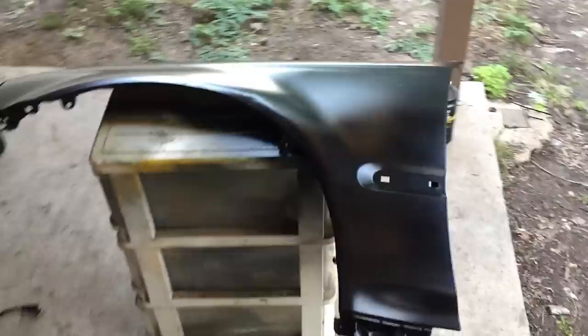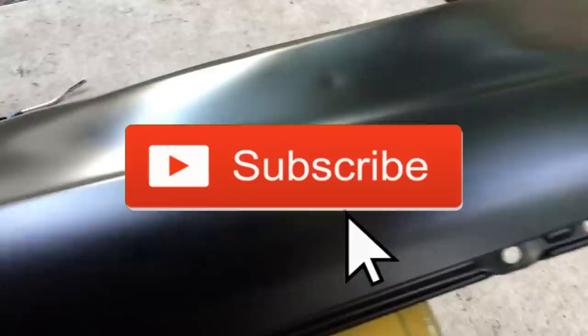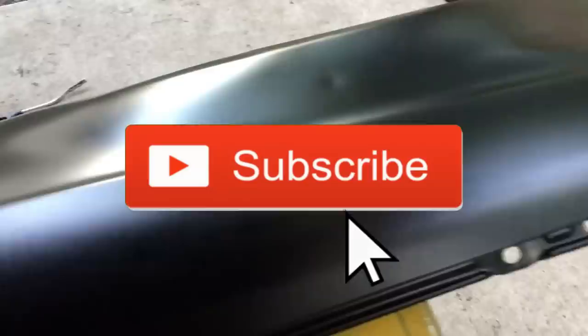Overall it looks pretty good — for a three dollar can of paint, this stuff works really well. You can see those scratches deep in the paint; I could have sanded those out with the 220 then stepped up to 320, but I wanted to show you what it looks like if you don't sand properly. The hail dents are pretty prominent, but if you're not worried about those, it looks pretty good. That's basically the final product. Definitely stay tuned to both channels — if you haven't subscribed, link will be in the description. Like the video, drop a comment, and God bless.